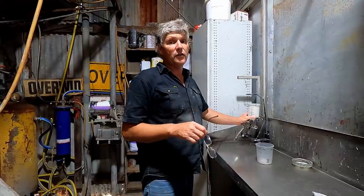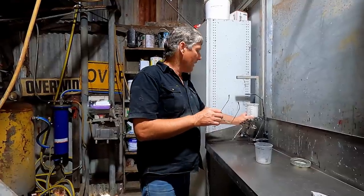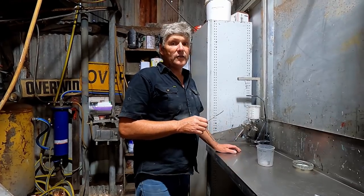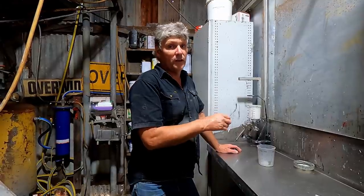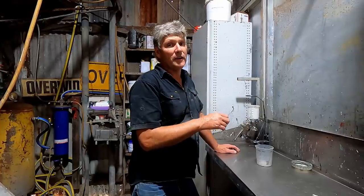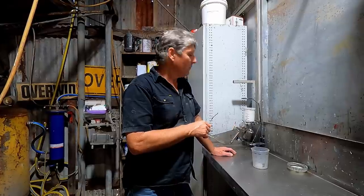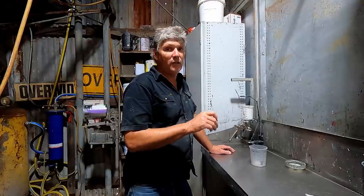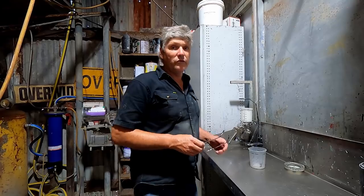Now, if you're thinking about doing the same thing, not all epoxies can be recoated straight away. Some of them need to be baked and cured and then sanded before they can be recoated. This one will do it, and I think it's a step in technology. So this is a BASF one, so it's a high quality product, but their old one, you had to actually let it cure before you could do anything with it. And strangely enough, in their cheaper range of product, they have one that you could wet on wet it. So it's all evolving all the time. So this one here we can wet on wet, so we can get away with that, which is good for us because it sort of means we can just go from one step straight to the other, and then we're sort of ready to start looking at colour once that's all cured and dried.